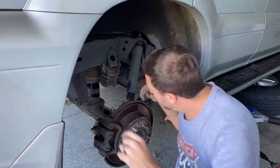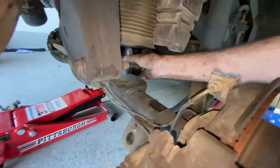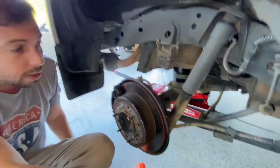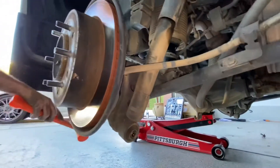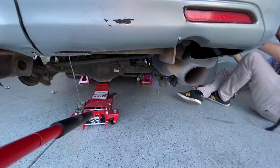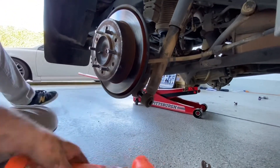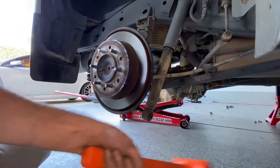So I was going to try to take the airbags out — these are the airbags. But why aren't they dropping out like I see in the videos? I have to take this one. The 17 millimeter at the bottom of the shock — this bolt went in here. What I did is raised up the old axle a little bit so I can get a better angle. And I'm going to see if I can hammer it off. It looks like it's coming off — it's almost there. Let's get this bad boy off.